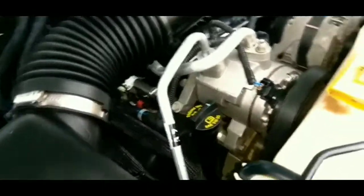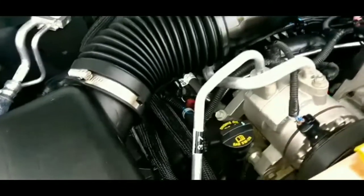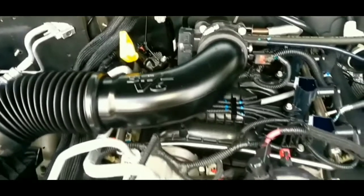So I turned on the headlights and checked the high beams to see whether they were strong, just to gauge where the battery was at. I went out and checked — the headlights were very, very strong. At that point I was thinking it probably wasn't the battery, so I popped the hood to look at it anyway.